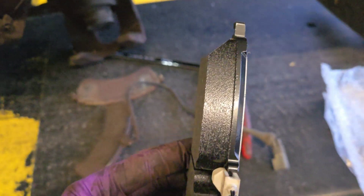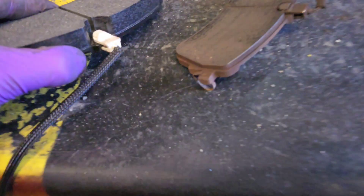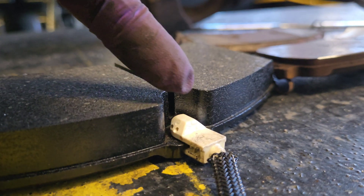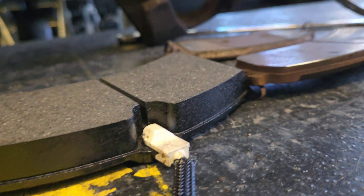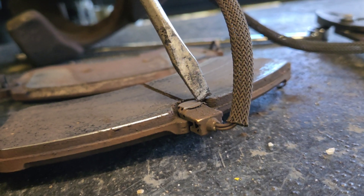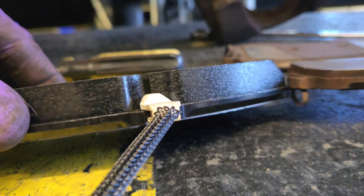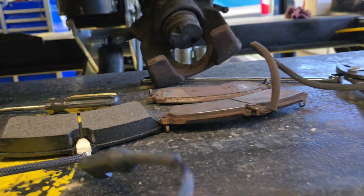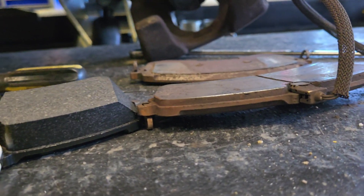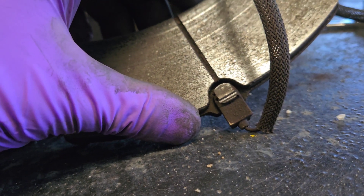Here's my new brake pad — that's some thick brake pads for the back, look at that — and there's the sensor. See how the new one has that hump on it? The old one is flat, even with the brake pad, because it was starting to wear down. What it does is it breaks the connection inside and creates an open circuit, sending a signal that your brake pads are worn.